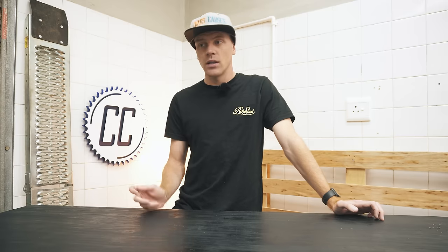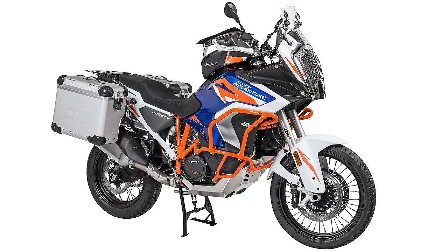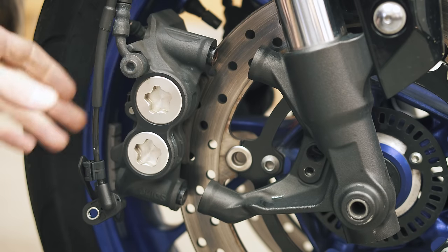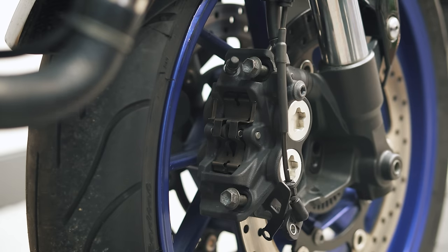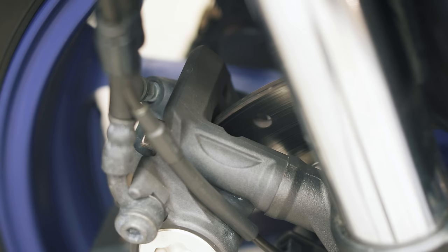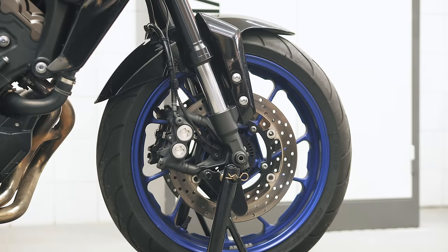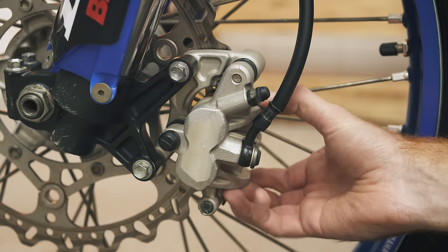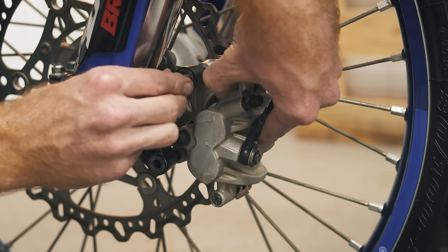Radial brake calipers were first developed for racing, so now they're synonymous with performance, which means any sporty or expensive bike is now expected to come with radial calipers — and for pretty good reason. Radial calipers usually sit on locating pins and then bolt down with bolts at each end of the caliper. This helps improve alignment with the brake disc, reducing unwanted brake rub and increasing stiffness under severe braking. In contrast, an axial caliper usually has more play and flex in it, with their lack of locating pins and more centrally located bolts.